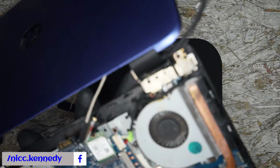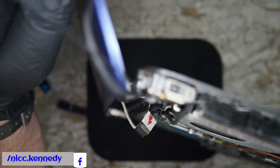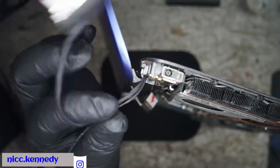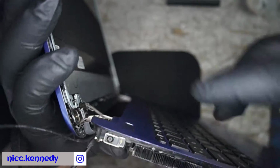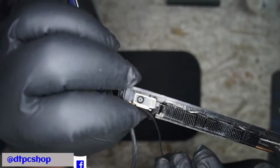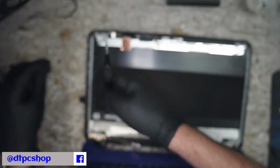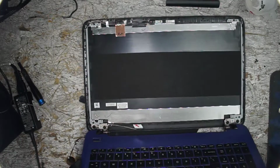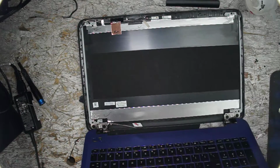There's that little spot. If you want to see it, what I was just doing battle with, we'll get a side view of it. If it will focus again, undoubtedly it's probably not going to. Zoom out a little. Is that better? Yes. It's right here. There's a little slot going off of the piece of plastic that is the top case where the keyboard is. Right there, and that's where we're going to start wrapping our wires around, and we need one to go over to the Wi-Fi card, one to the display. We still have a screw or two to put in, and we'll put this display in and snap our bezel back together, and then route the wires on the bottom. We already did the testing, and everything's working there, so hopefully progress.